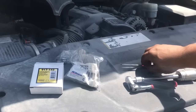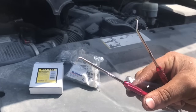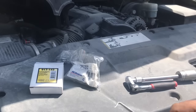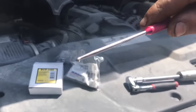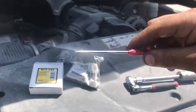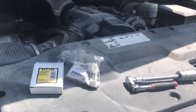What we're also going to need — and these are the crucial parts — is a 90-degree pick, and another pick that we're going to use to extract the actual screen. The 90-degree pick is what we're going to use to push off one of the hoses — specifically the booster hose — and that's going to be a crucial part to make this job a lot easier. So let's get back here and see what we're getting into, and hopefully we can take this off pretty fast.